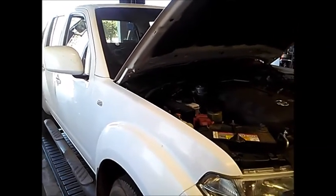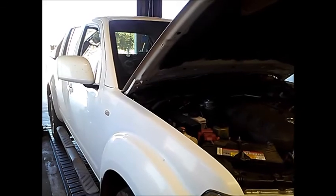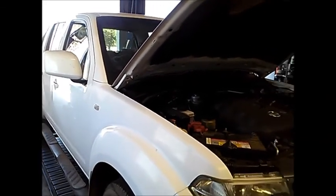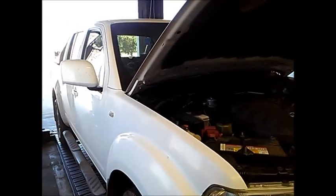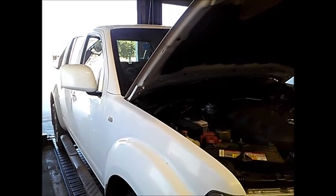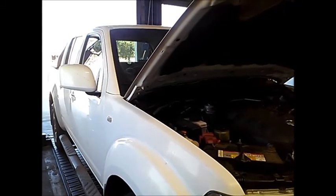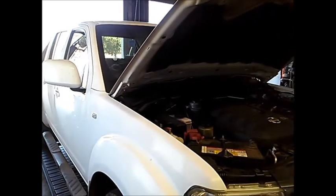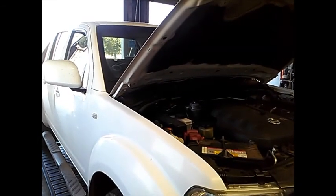The owner's had it for a few years and has never had a service done on it. He's mentioned it's getting pretty sluggish pulling his van up hills. I've just taken it for a road test and it's a bit sluggish even without anything on it — selecting first gear and just taking off hard, there's a bit of a flat spot there. So we're going to do a transmission service and have a look inside at what's floating around in the pan.